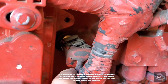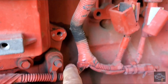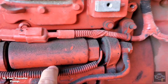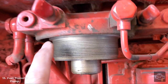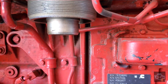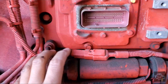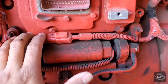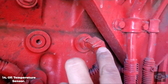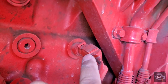Following the harness down here, this part is for the fuel transfer pump — the one that fills up the fuel filter when it's empty. That helps prevent air from getting into the system, which I really like from Cummins. The next one is the oil temperature sensor. It looks similar to the coolant temperature sensor but is located in a different place.